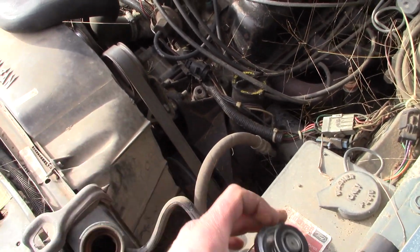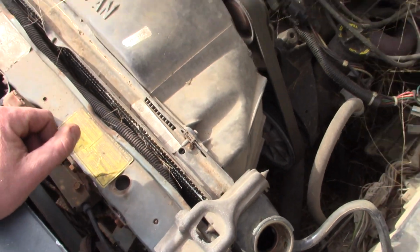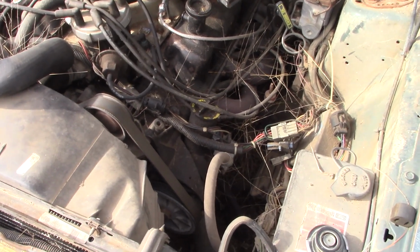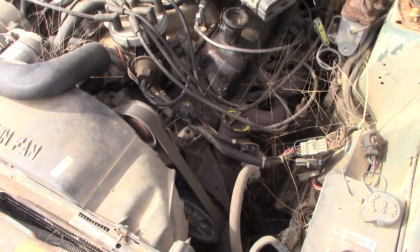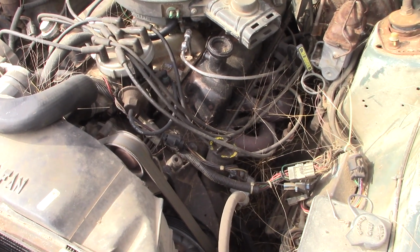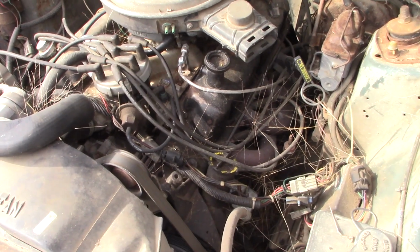We're going to put some in there, throw a battery in it. I guess I see a little tiny bit way in the bottom, so I'll have to figure out where that's going. But get that topped off. Check the transmission. It's reading full now, but it should be over full because it's not running. So I have a feeling I still have a leak somewhere, but that's okay.